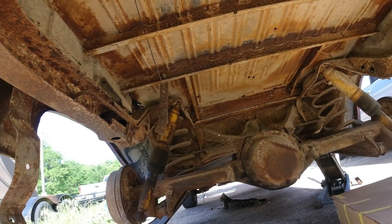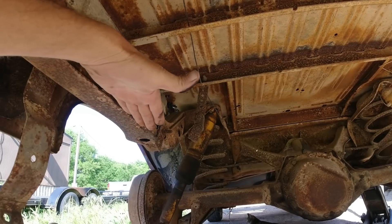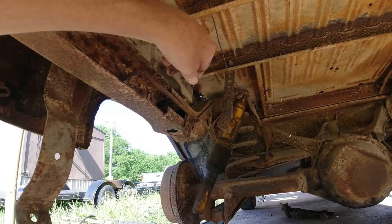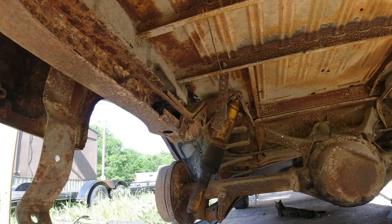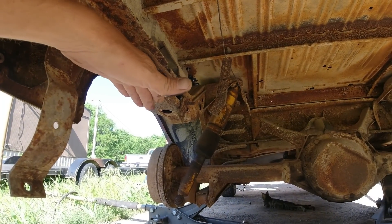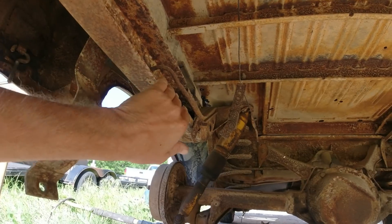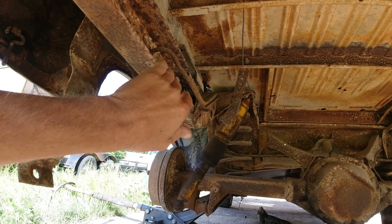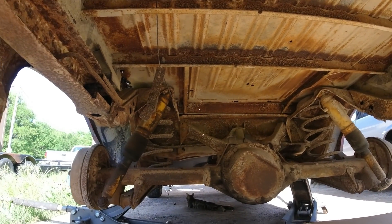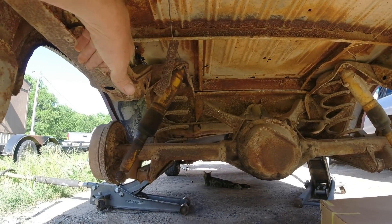The other alternative would be to put a box here — it would probably come down to about the bottom of the frame. I don't know how many inches that is exactly, maybe 10 inches from here to here. The other alternative would be to put a tank right underneath the box, but I don't want to go below this frame in case it bottoms out — I don't want a gas tank caved in. So you'd put a gas tank there and you're not going to have very much room for a box. I'm probably going to get under here, clean all this up, and figure out a box from the bottom of the frame up — so it's going to be about a foot deep. That'll be pretty good.